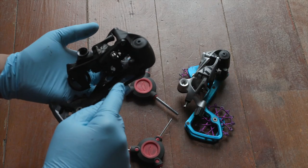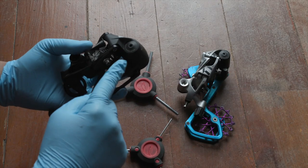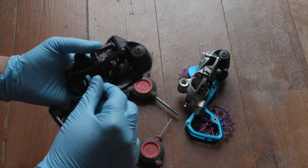And that is just bonkers. So in this case, the bad idea is we're going to do a derailleur hack that SRAM probably doesn't want you to see — or maybe they do, because you have to buy two derailleurs to do it. Essentially, what we're going to do is take the long cage from an NX Eagle derailleur and graft it onto a Rival road derailleur. This way, the derailleur has mountain bike capacity but can shift with a road shifter.